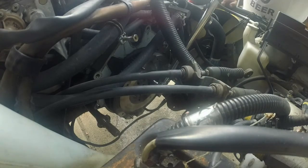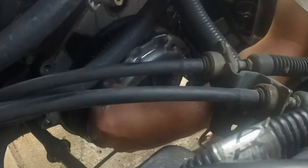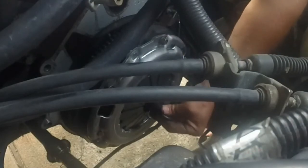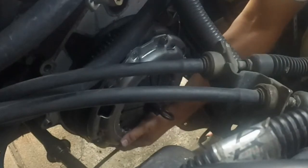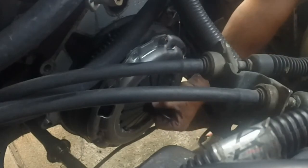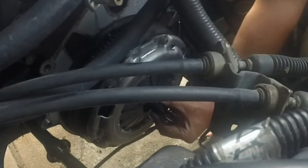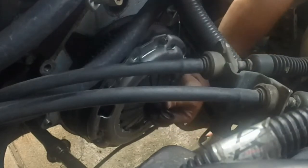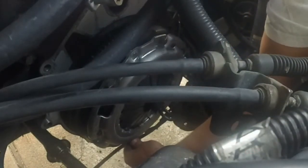I'm going to get an extension to make it a little easier to tighten these down. Now I got all the screws in. I want to make sure the alignment hasn't moved. I'm going to hold this up a little — make sure we're good. I got a little wiggle in there. There's no pilot bushing on these cars, so it just sits in there. I'm going to make sure she slides in and out, no problems. We're going to just start snugging this down. You always want to make sure you check that spindle — that it slides in and out nice and easy.